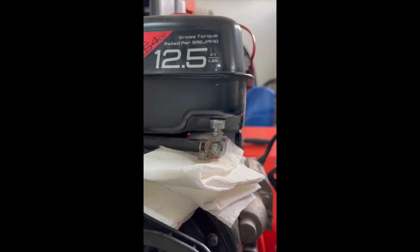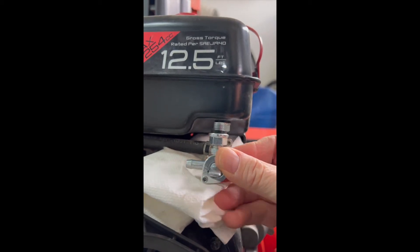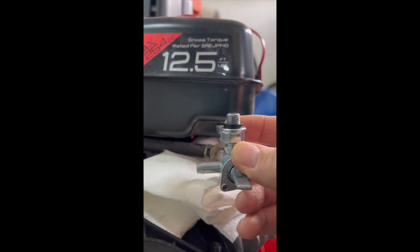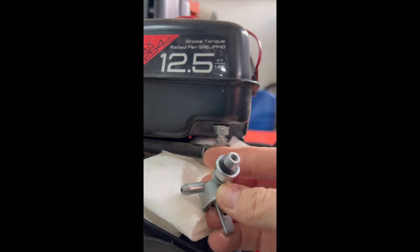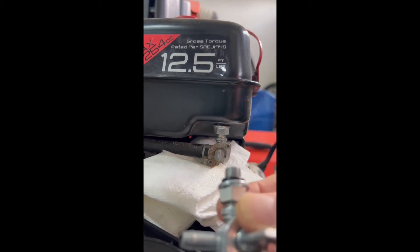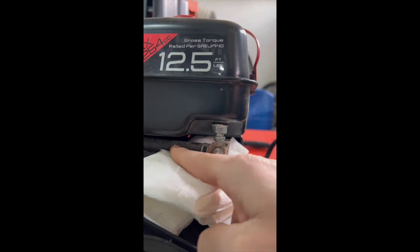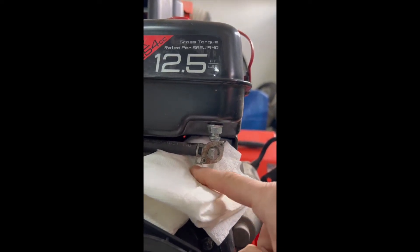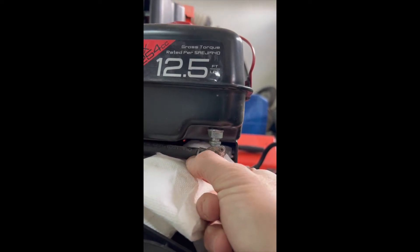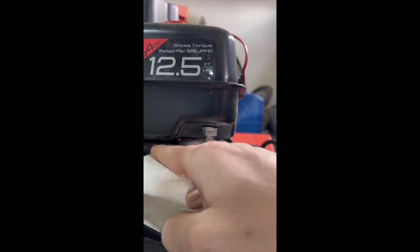What you'll want to know is that's how the valve seats there. Eventually you're going to need to spin this piece off the old valve. I'd recommend disconnecting the fuel line first from the old shut-off valve switch, then get the fuel line out of the way — that's probably where it'll bleed out some excess fuel. You're going to squeeze on these two pins here and get this tension band off first, backing it off about an inch or two.